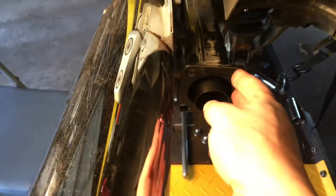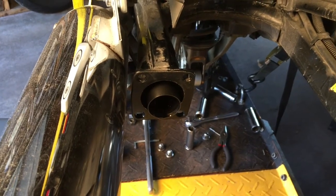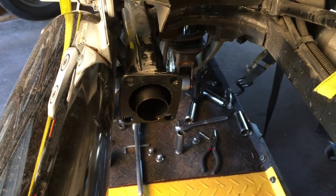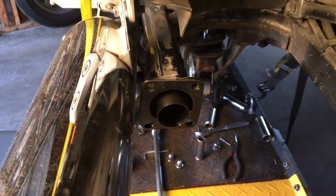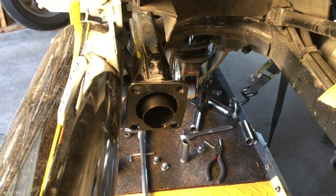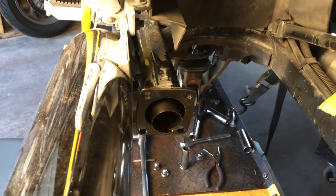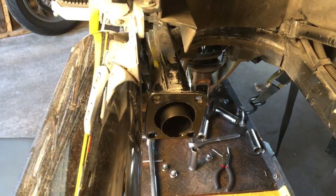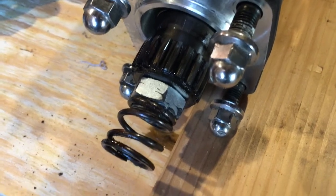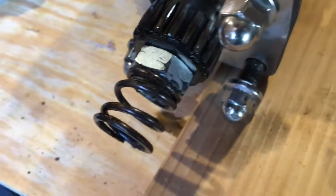I took the final drive off — just four nuts. A lot of people would say take that off when you take the rear wheel off, all in one, which is maybe a good idea, but there's more than one way to do a thing. Anyway, that'll make the swing arm ready to come off of the drive shaft, which will be next. When you remove the final drive, it will have this spring on the end, so be careful not to lose that. This is how it goes on the end.